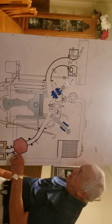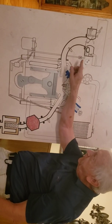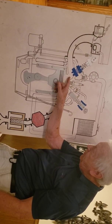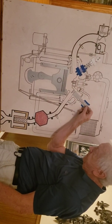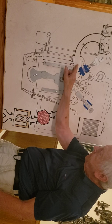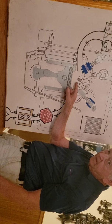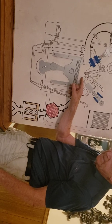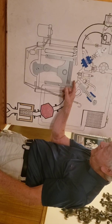And now in today's car, you've got what they call fuel injection. So instead of your fuel coming down through here, all that comes down through here is air. Like when this valve over here is open, this lets the air in. The air comes in here, and this here sprays your gas in. So when you're using your pedal with fuel injection, are you still deciding how much gas to let in, or just how much air? Yeah, it works both of them.